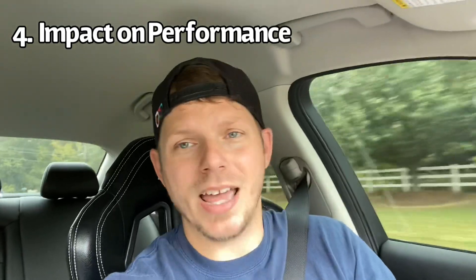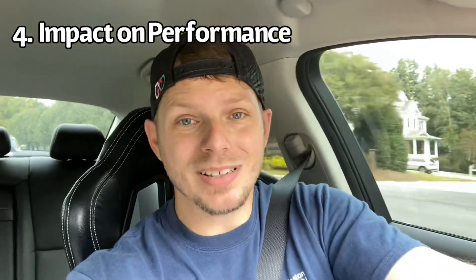Pro number four: this is one of those things where it's a pretty minor part — not bulky, not noisy — but you can still feel the difference and impact it makes, which is always nice when you spend your hard-earned money on something. Unfortunately, it's not something you'll really feel in a typical daily driving situation, but you can certainly tell the subframe is more rigid and the collars are doing what they're supposed to do. You can feel road imperfections more amplified now that they're not absorbed through the rubber bushings, and the tires break loose a lot easier around corners and in straight lines, with that energy now being transferred directly to the ground rather than absorbed.